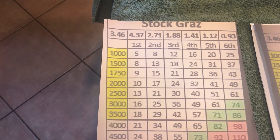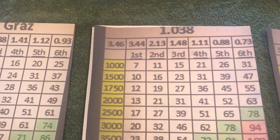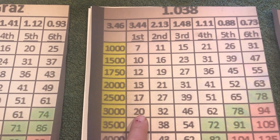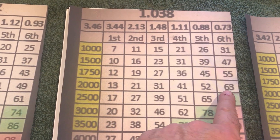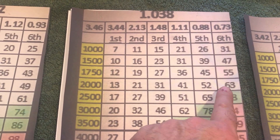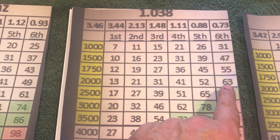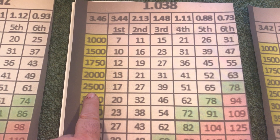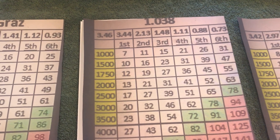There are a number of solutions to help fix this. The most popular set of gears changes the standard gear to a 1.038 drop gear. At 3,000 RPM you're doing about 20 miles an hour, which isn't too bad. But at 2,000 RPM you're doing 63 miles an hour — so if you're in a low speed limit area that's fine, but out in Montana or in Jersey where the speed limit is 65, you're probably going to wind up cruising at about 2,400–2,500 RPM.